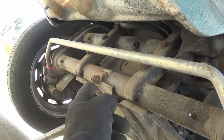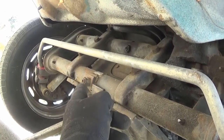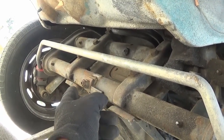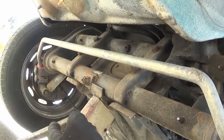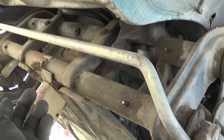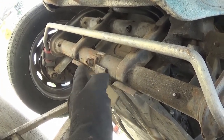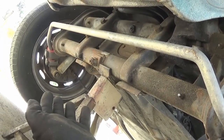I remember when we put those spring adjusters in the beam. Boy, is that a dirty, nasty job. But we welded in those, they got teeth on them. And you jack them up like this, and then you loosen the lock screws, and you put an Allen wrench that fits in the end of that. And generally, you can raise or lower this thing. He liked the low look, like a lot of guys do. And the tires would have a tendency to rub because it dropped down. And these are the stock size wheels and tires, 165 80s and 15s. So I put it back where I thought it should be, normal ride height, so the tires wouldn't rub all the time, and I could turn and things.